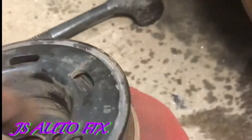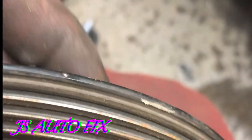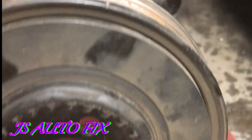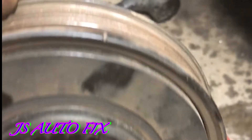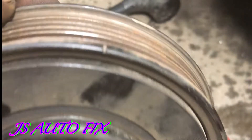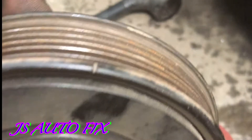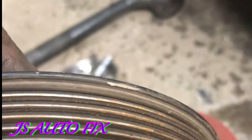In this video I'm going to show you how to find the timing marks on the crank side of things. The cam side is pretty easy, but the crank side — I had the car on the hoist just looking at the side of the pulley like this and I could not see the mark. But if you look up top you can actually see the mark right there. It's a big groove that's cut into the pulley.